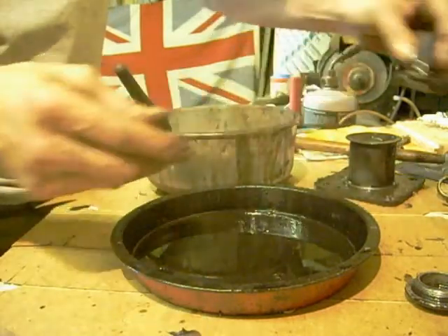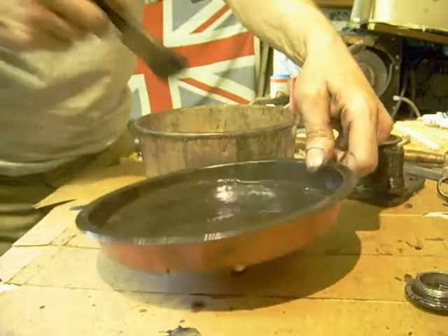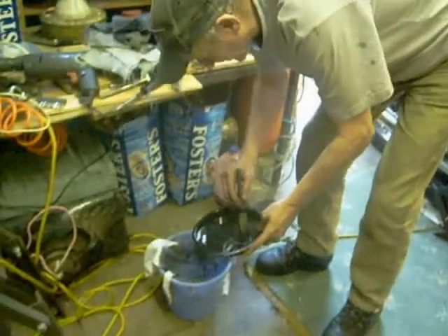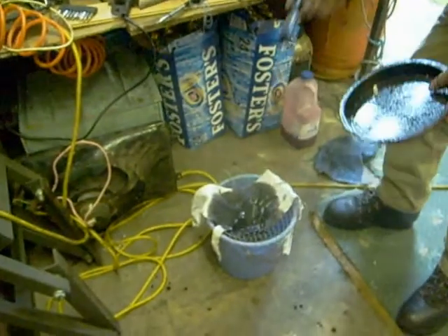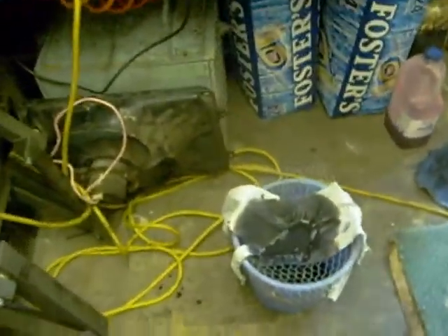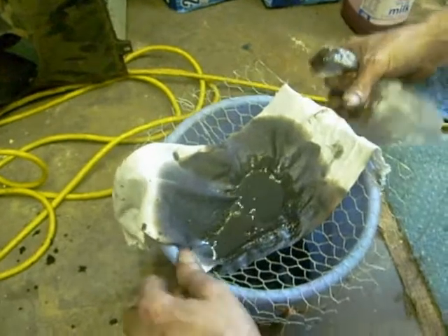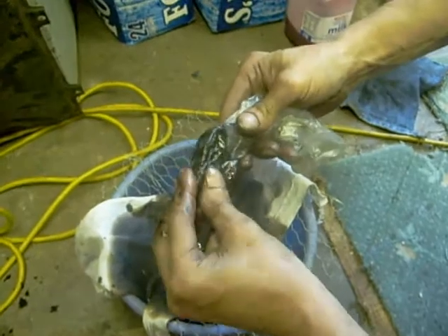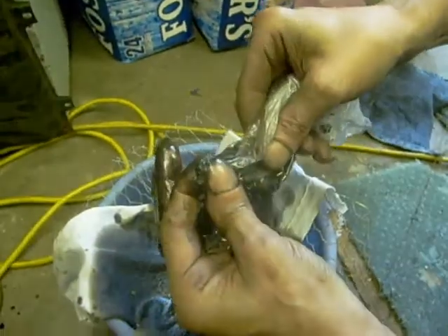No bits in that, so I'm quite chuffed for what's come out of the engine up to now. Now I'm going to filter it out through a t-shirt - it'll give us some idea what the engine's like. If I use a magnet, I can see if there's any steel in it. Quite a lot - yeah, there you go. That's steel.